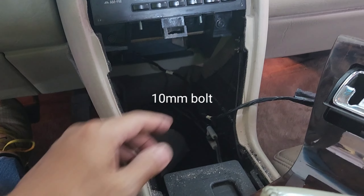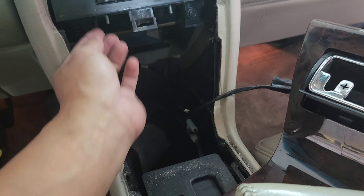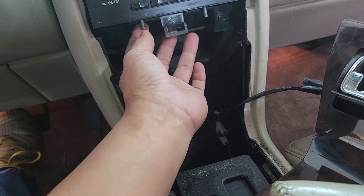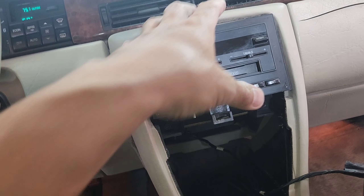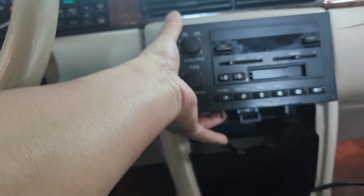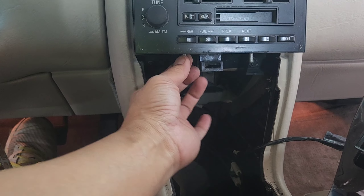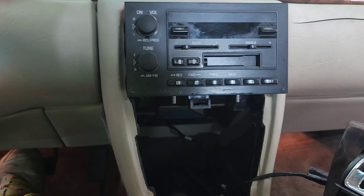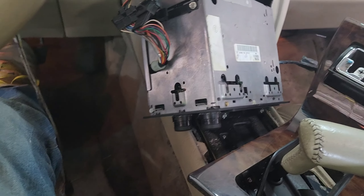I've done many of these back in the day but I haven't done it for a while. You gotta take this 10 millimeter — actually somebody took it out already. The customer, or whoever sold the car, installed the radio and then took the radio when they sold it. So you've got a 10 millimeter right here and a 10 millimeter right there — take those out and then pull it straight out.